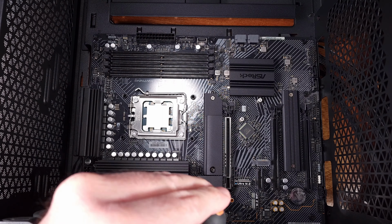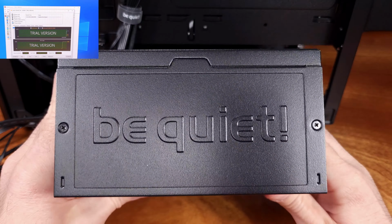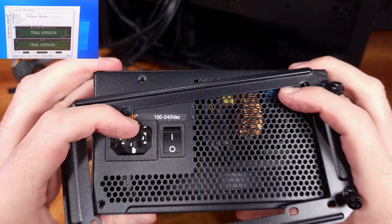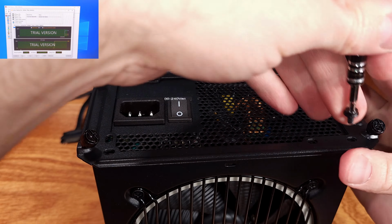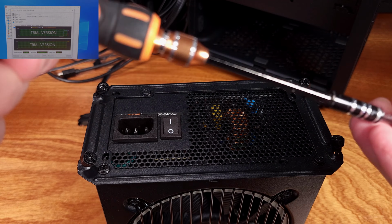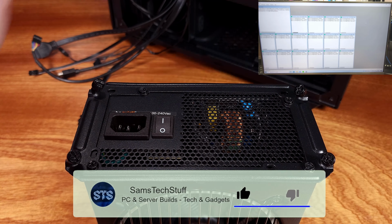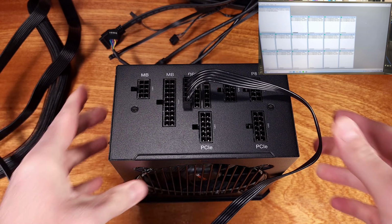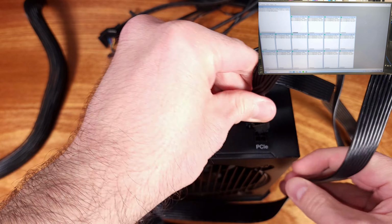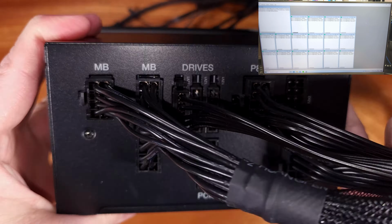about 1935 MHz. In the AIDA64 CPU test, the 70% fan speed test produced an average core temp of 79.1C and an average clock speed of 5.15 GHz. Switching the fans to 100% fan speed saw an average core temp of 67C with an average clock speed of 5.27 GHz. Lastly, for the Prime 95 smallest FFT testing, the 70% fan speed test saw an average core temp of 89.1C. We hit about an average of 5 GHz across the cores. In the 100% fan speed test, the average core temp was about 82.7C with an average all-core clock speed of